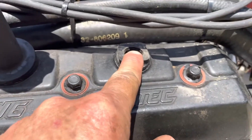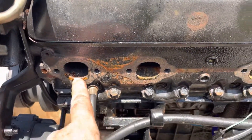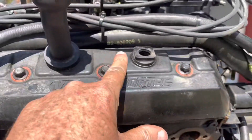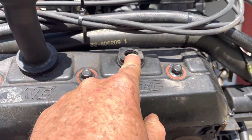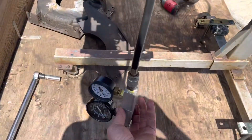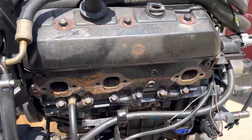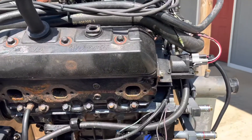I just heard some air coming out of this port, so I'm testing number one one more time. I can hear air coming out here, but quite a bit coming out of the crankcase port — I can put my ear to that hole and actually feel the air blowing across my earlobe. Number one has pretty bad leaking rings. It was holding about 75 psi, which is marginal, but definitely leaking a lot past the rings. I would say number one is a failure.